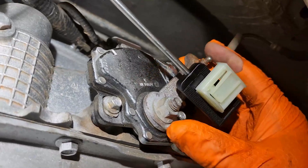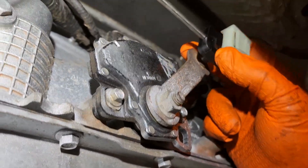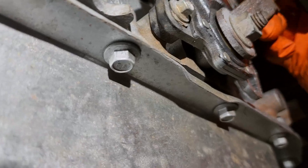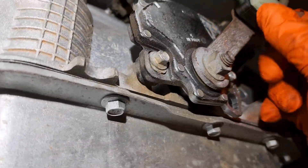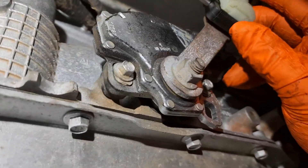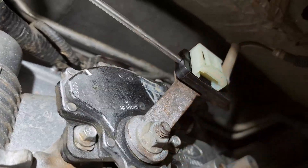You can go ahead and move the gearshift position to help line up with the gear shift cable — it should be in park. We'll go ahead and snap it in place. This is the part where your gear shift cable can be adjusted if needed, though it shouldn't need a whole lot. We'll lock it in place.